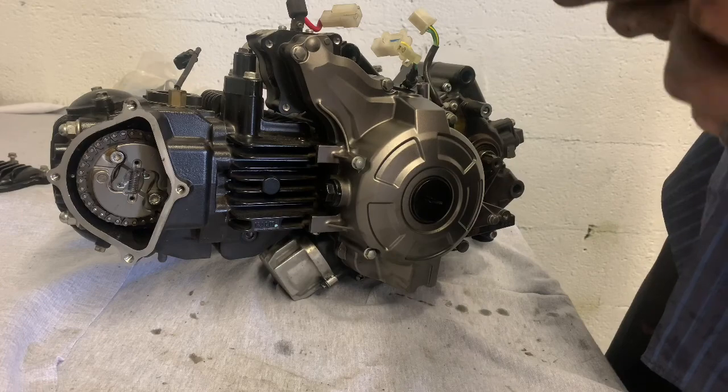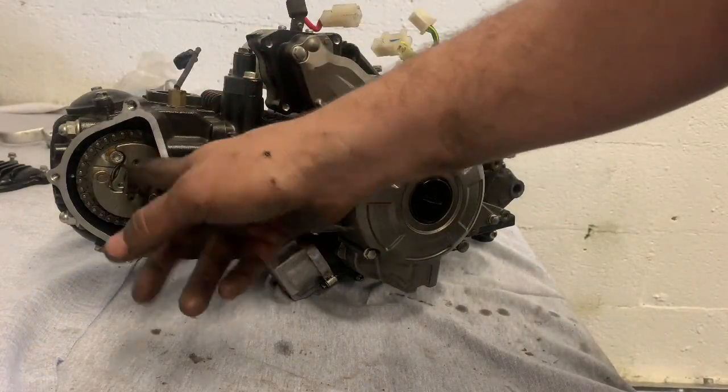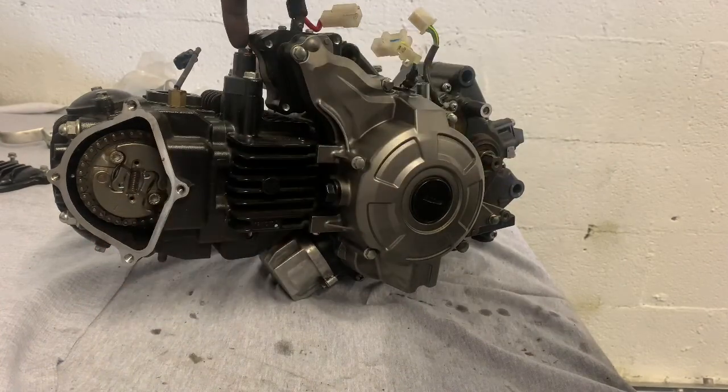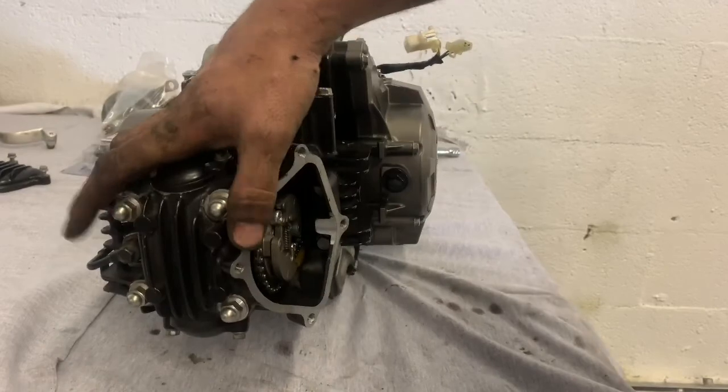Pull that off. Now I've gotten the oil drain, I'm gonna spin the motor over, pull my cam bolts out to get it loose, pull my tension loose, and pull the top right here so I can put all that back together when I go back together with it. So I'm gonna go ahead and pull the top cover off so I can do the adjuster.